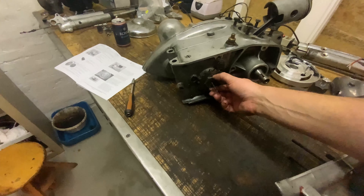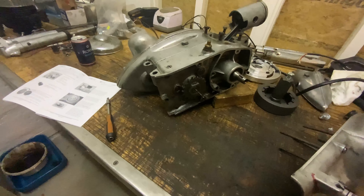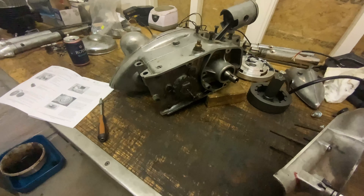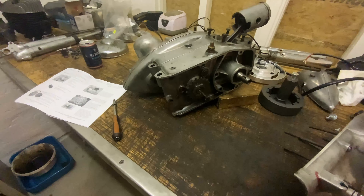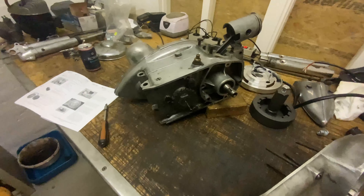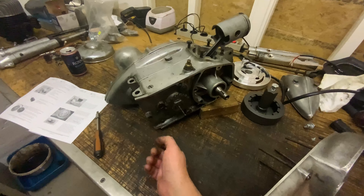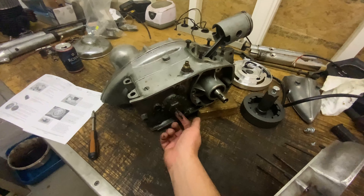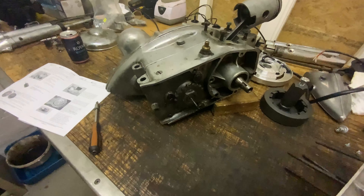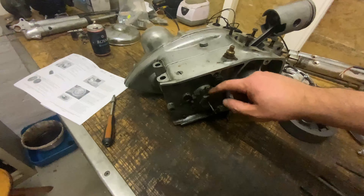This thing is a size 36 — a rather uncommon size — and I was struggling with it for a few days. I had to find the right tools, and it turned out not to be an adjustable wrench but a real socket. I struggled and struggled because I was trying to undo it the right way. My dad pointed out that the driver is on that side, so all the forces go that way, meaning when you accelerate the inner axle from the gearbox will undo this bolt. So I tried going the other way and yes — this is a left-hand thread bolt.